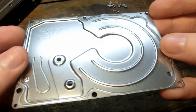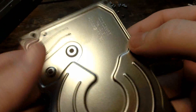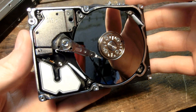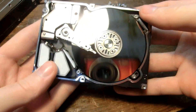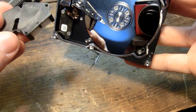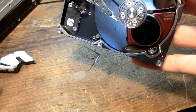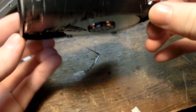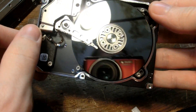So first off we have the main cover of the hard drive — it's actually quite thick and durable. It has a bead of sticky rubbery compound around it that seals it. And here we have the internals of the hard drive: the read-write arm, the magnet that turns it. I guess this would be an air purifier system inside here. It seems like there's silica in there or something to absorb moisture — you can hear it rattling around. And here's the little interface where the information and commands go from the main board through this little ribbon cable and into the arm.